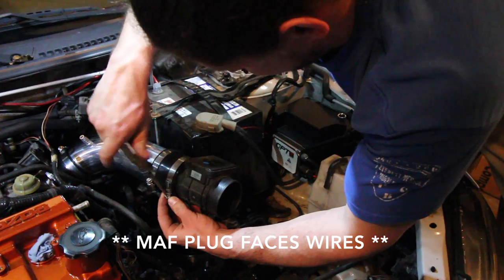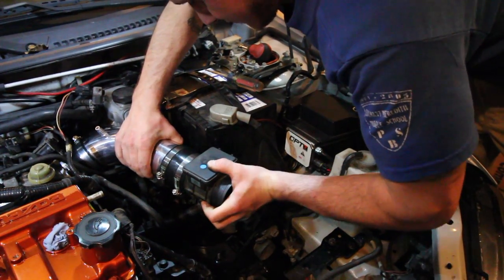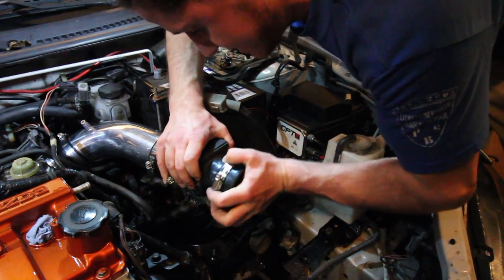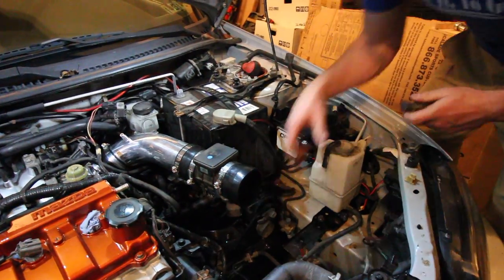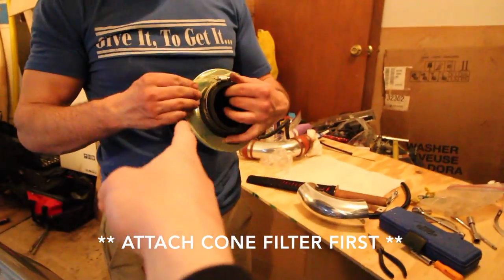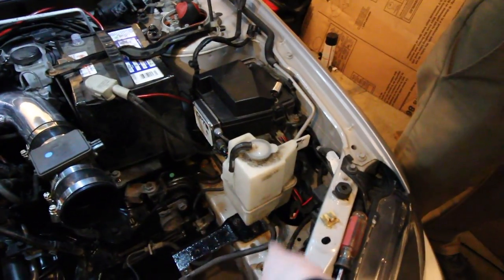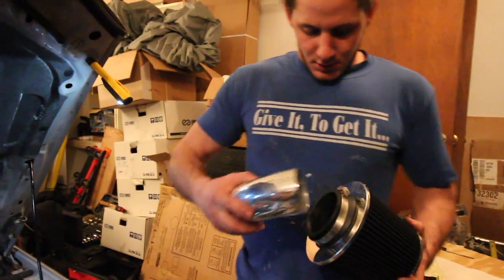It's on there. Nice — air flow plug side this way. I need the last one of these. Very tight squeeze. Can we get a wider mass air flow? That'd be so nice. I don't think so — that's the stock one. Alright, so just to make it easier to put it on there, what we're going to do is attach this coupler and that tube first, because that way we can put it on there easier. Otherwise we're fighting with this tight space and it's way restrictive — this will be way more efficient.